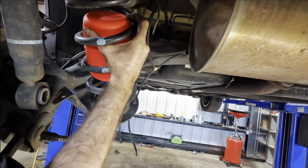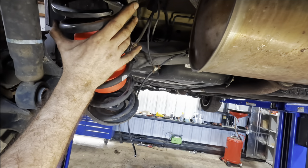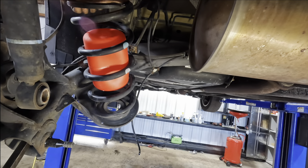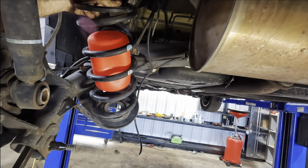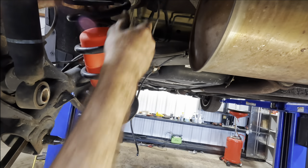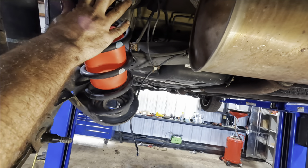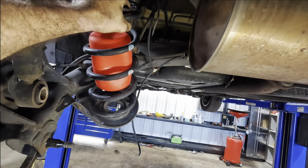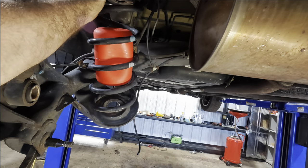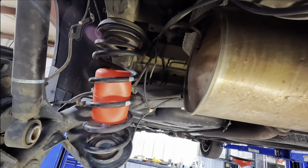So, set the spring, set the new bag back in. I'll get the isolator referenced properly — pointing that way. Now I just need to pry this axle back down and shove the spring back up into its position. Sketchy — some slippage. Need more leverage. Need another hand — Dave's not here. All my weight's on this pry bar. There we go, got it. A little bit of oomph at the top — sent it home. Good.